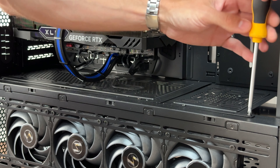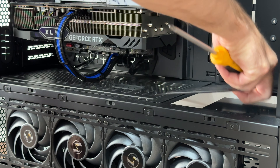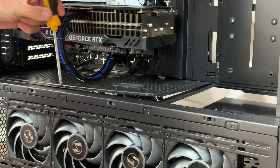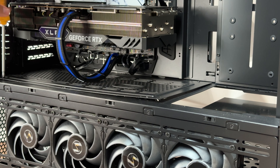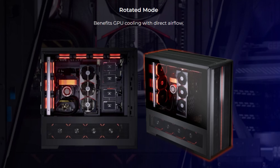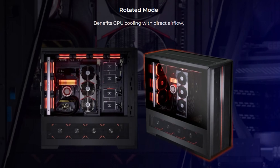The SSD brackets are tool-less — remove the top bracket, place the SSD onto the standoffs, and lower the bracket back down to secure it. In dual system mode, the top power supply shroud grille supports 2x120mm or 2x140mm fans, or a 240mm or 280mm radiator. The side power supply shroud supports the same as standard mode but without the hard drive cage or GPU for the ITX system. The rear supports a 120mm or 140mm fan. In rotated mode, the top power supply shroud supports a 120mm or 140mm fan, and the rear side of the case is inverted, supporting 3x120mm or 240mm fans, or 360mm or 280mm radiators.